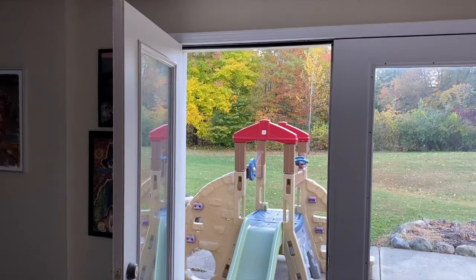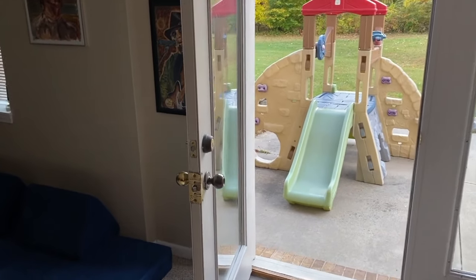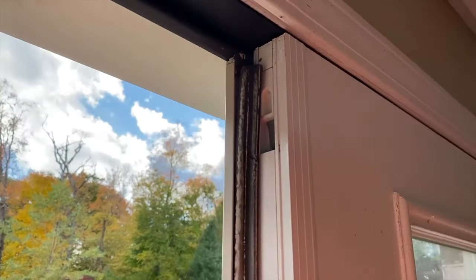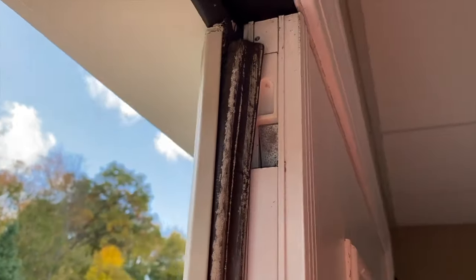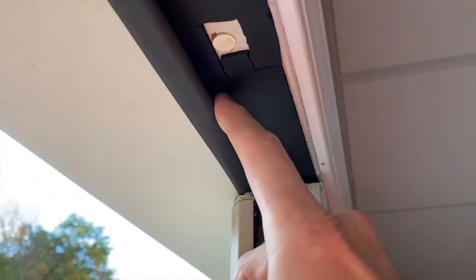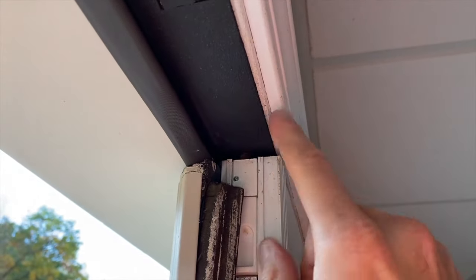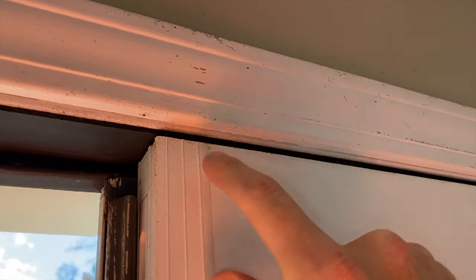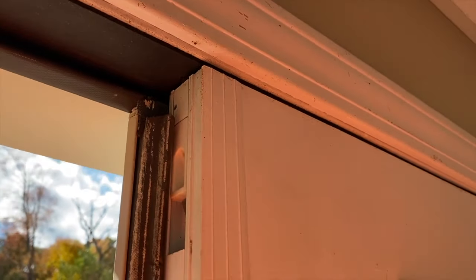At this point I've got the main door open. Your main door is the one that has the deadbolt, the latch, and doorknobs or handles. Coming back to the center weather stripping, you can leave this door as is — you do not need to open it. You can see our locking shaft is up and in. Also, in the event that you replace your weather stripping and you're still getting a cold draft, or you can see visible light coming through the seam between your upper trim and upper portion of the door, we will post a link on how to install additional insulation tape — definitely check that out, it is below.